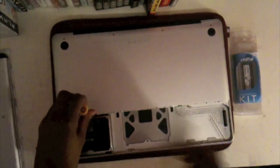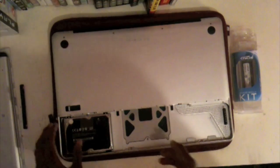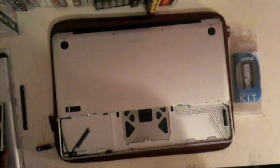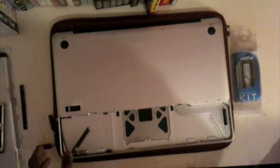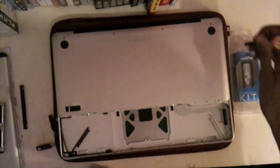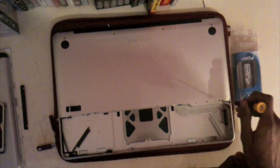I've put something on the table just to protect my MacBook. It's good to place the screws exactly where you take them out from, just so you remember where they go, as some of them are different sizes. Then you want to pull out your hard drive and take off the little black bracket, then you need to remove some more screws — there are four along the top as well as four along the bottom where you removed your battery and hard drive.